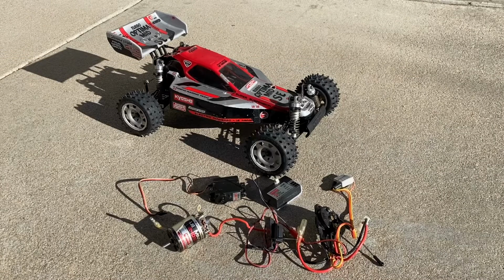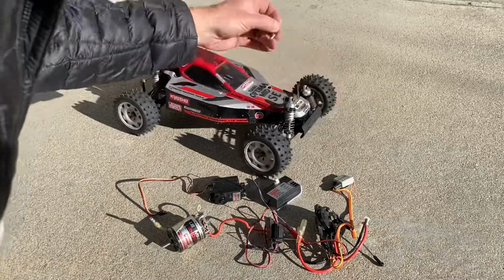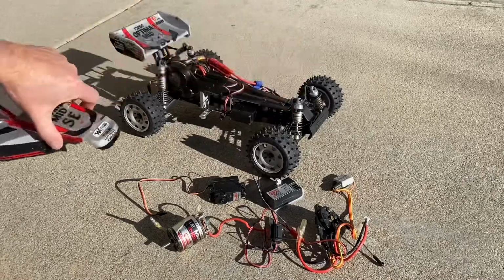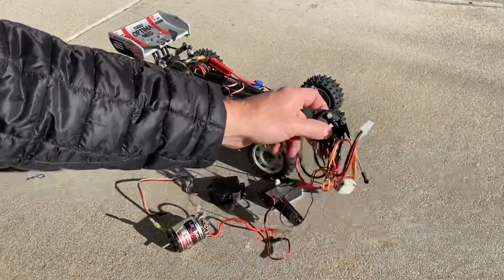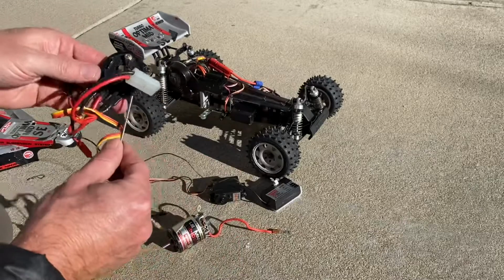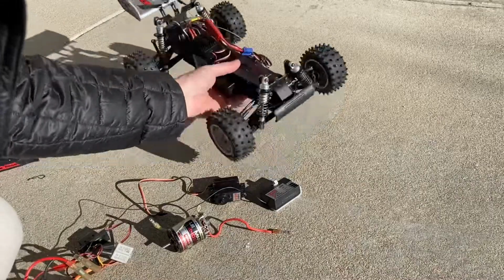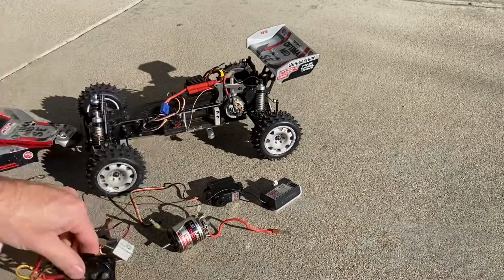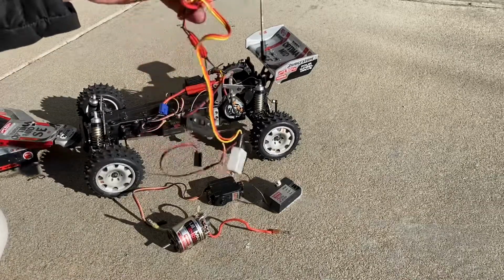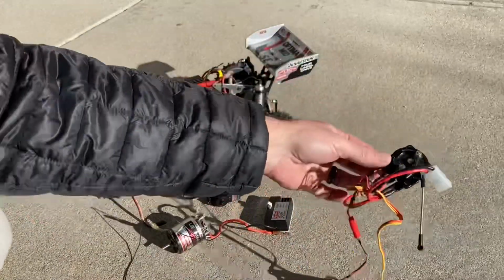Okay guys, as noted, we had to do some pretty serious electronics gutting of this car in order to get him running. This is what came out and what went in. This is the original speed control right here, so anybody who hasn't seen one of these, this is a mechanical speed control that's controlled by a servo, so you had two servos in these cars, and it basically rotated. This used to mount up here, in here, and this thing works, still would work. We only had reverse at first, but we cleaned up some contacts and got it working. So that's the first bit that we replaced.